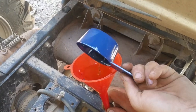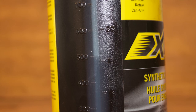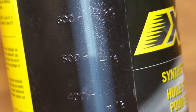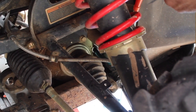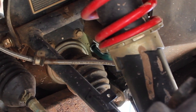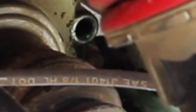After trying several different methods, I found just setting the bottle on a level surface and using the marks already on the side of the bottle to be the most accurate and precise way of measuring the prescribed 500ml for this front diff. I also believe Can-Am uses a fill-till-it-spills setup on this front diff, because the oil level appeared to be just below the fill plug after adding the correct 500ml. Comment below how many milliliters your front diff takes before it spills when you do this job.